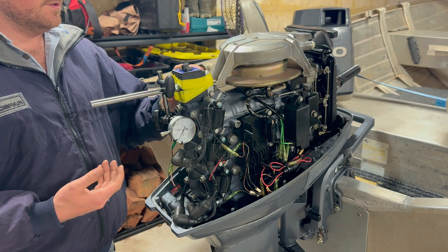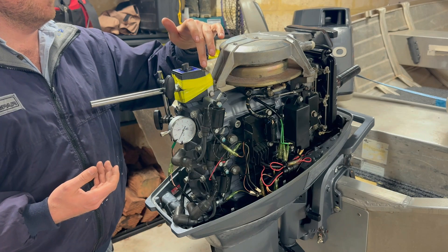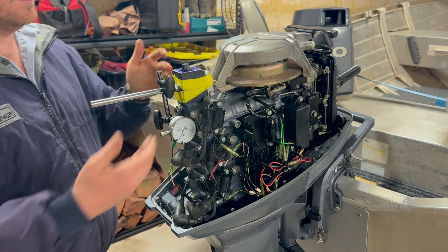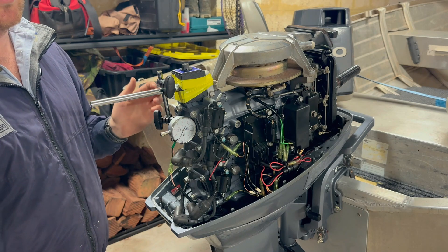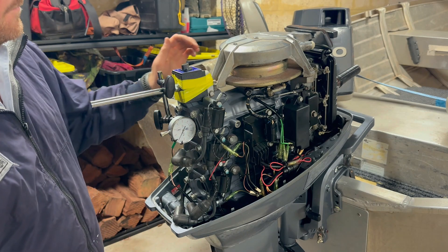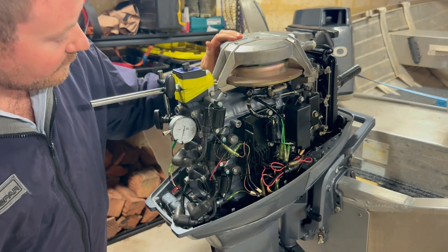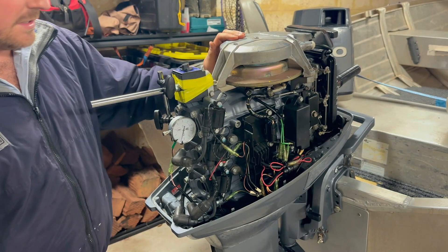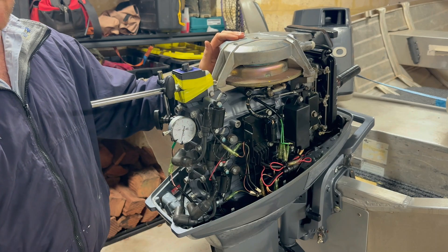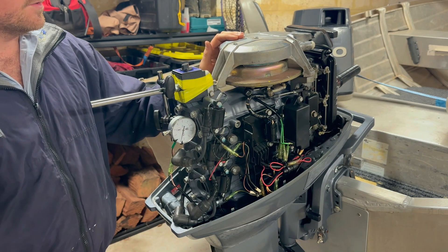The engine head and block are all aluminium, so I've used my magnetic mount on the steel lifting point, with some tape in case I knock it so I don't drop the dial indicator. I've picked up top dead center. Rotating the flywheel clockwise as viewed from above — that's the direction that allows the water pump to spin correctly. Spinning it backwards may damage the water pump as it flips the fins around on themselves.